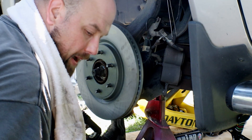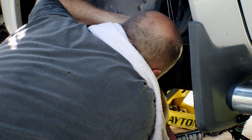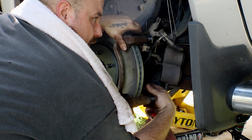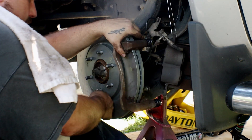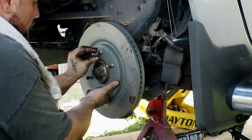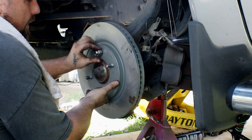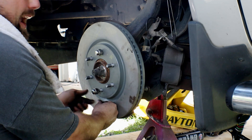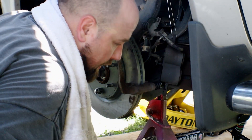So now we're going to put these bolts back in — remember, we've already got Loctite on them. Bolts just screw back in. Here's a nifty little trick for you: if your rotor doesn't want to stay on, simply take a couple of lug nuts and spin them all the way on — just hand tighten them, they don't have to be super tight. This will hold the rotor back far enough to where you can get your caliper and everything else on without any issues.